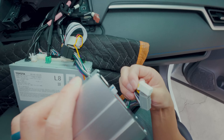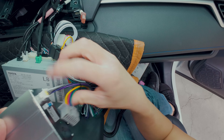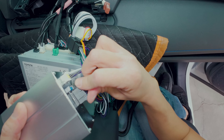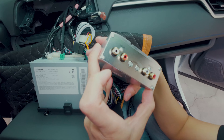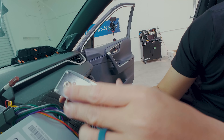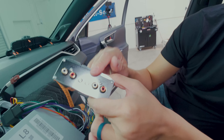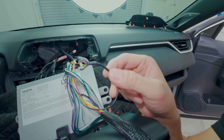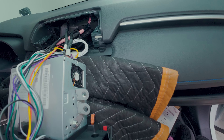Next step, grab your amp and let's connect these. Push it in — there it is. The default gain is going to be at 50% front and rear. For this model, it's probably going to be very close to keeping it at 50% front and rear — we're going to do some testing right now to find the optimal gain and then share it with you. And let's not forget to ground this ground terminal — we'll ground it here to the side bracket. You can pick any of those.